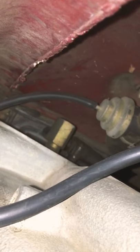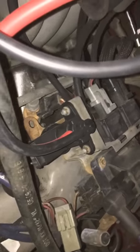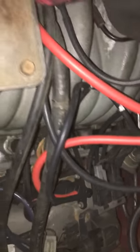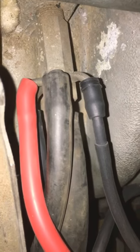There's another one back here — there it is. This one is gonna go right behind the EGR switch, right there. There's one from the fuel pressure regulator, which is right there. It's gonna go below the red wire, right there, in between those red and black wires — you can kind of see it right there.